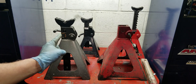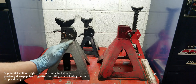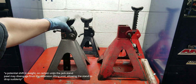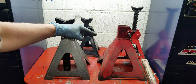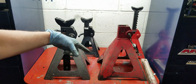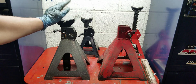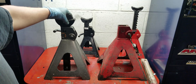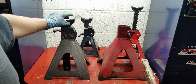I figured I would give this a shot and try to recreate the condition where this jack stand would become unweighted and then fully weighted again. What I'm thinking is going on is usually, sometimes on occasion, these can get stuck to the chassis. So if you're jacking up another corner really high, it may want to tip and lift off of a jack stand. Let's just assume it's getting stuck to the car, becoming unweighted, and then immediately a load is being put back on it. Let's see what happens.